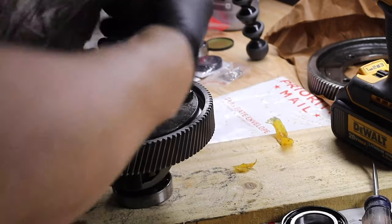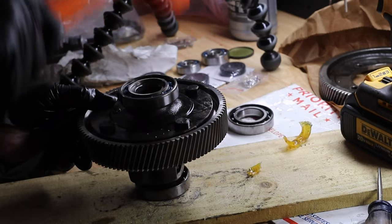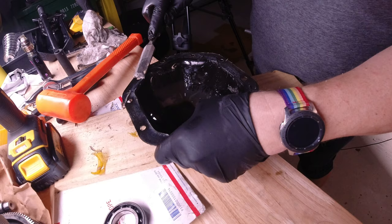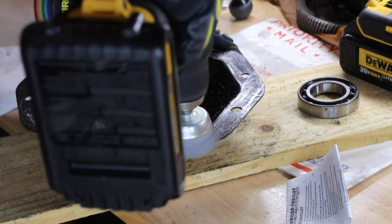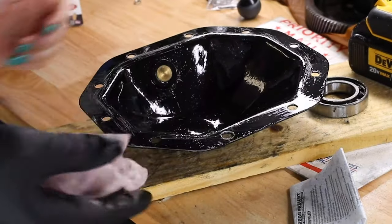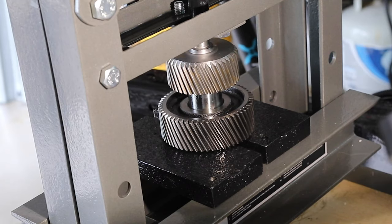So I wiped off the assembly and then took the new bearings I had ordered. I did order a bearing kit that came out of Jacksonville - it had the freeze plugs with it as well as new bearings for the shafts and for all of the gears. This is another area where I needed to clean this bottom pan. I started using a chisel to scrape that gasket seal off - that didn't work. I used cleaner to try and clean it as well - again that didn't work. The thing that ended up working well was a wire brush on the end of a drill, and you can see it turned out really nice once I was done.